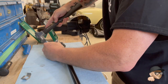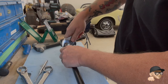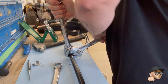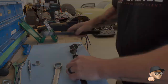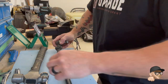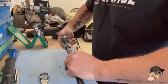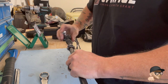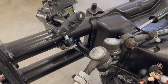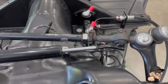Same thing here for the passenger side — this is the longer of the two arms. I went ahead and made the mistake of painting this one, but I know that when they do the alignment they're ultimately going to scratch it up, so it'll be one of those things I have to get touched up later. And voilà, here we are, all installed again. Everything's kind of rough and not locked down, but everything's torqued and sitting in the resting position. We'll get those locking tabs bent over once we get it aligned, then touch up the areas that need paint.